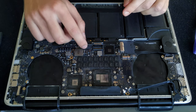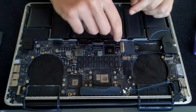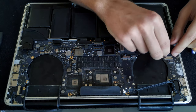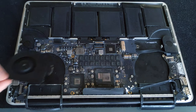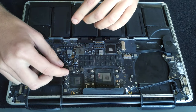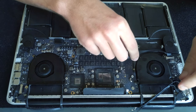The trackpad connector is easy to clip in but do not put the battery back yet. On the right side of the battery there is the right speaker connector that clips in easily as well. Then connect the IO board with the main logic board — it's the same kind of connection as the screen but there is a little more space. Then put down the left speaker — align the connector to the housing and push it in, then close the connector arm. Same with the right speaker — just push the connector in and close the arm.